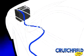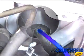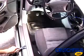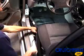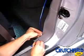The easiest method is to try and locate a place where existing wire passes through. Once the cable has been routed through, continue running it to the amplifier's location. In many vehicles, you can remove the door seal trim panels and route the power cable underneath the carpeting. You may need to partially remove the back seat if running the power cable to the trunk.